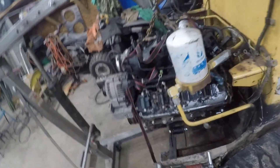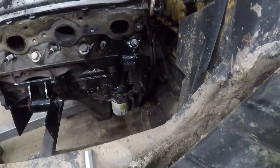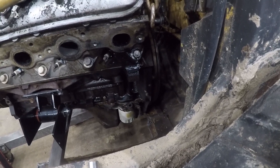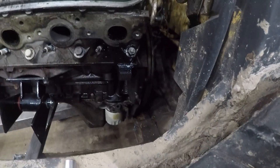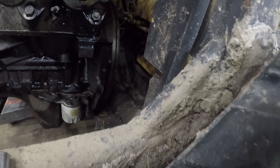Now what I want to do is make sure this thing is dead nuts on the pump. So what I'm going to do is go here where the flywheel is — you can barely see the pump — and measure those six inches. I'm going to take a little six-inch shaft temporarily onto the flywheel and use that to help center it up onto the shaft.